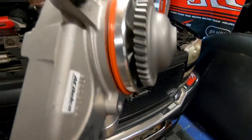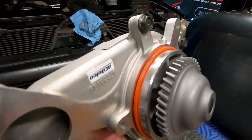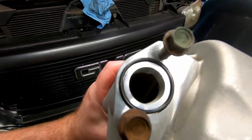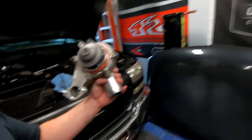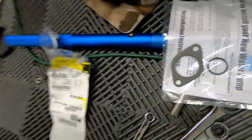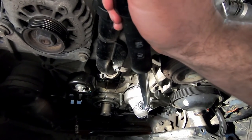Now that we're fully done disassembling, I've cleaned off the gasket surface for that back pipe and I'll spray a little brake cleaner on the gasket surface for the water pump. Here's the water pump ready to install — you can see the new orange gasket that came with it. I did install the new gasket on the bottom and the new studs I ordered separately. I noticed the AC Delco gasket is a composite gasket rather than the steel one that came off the old pump.